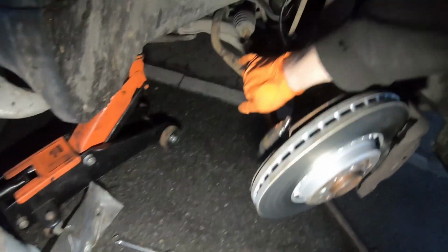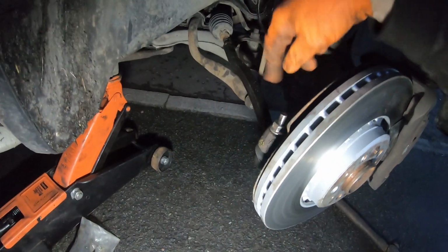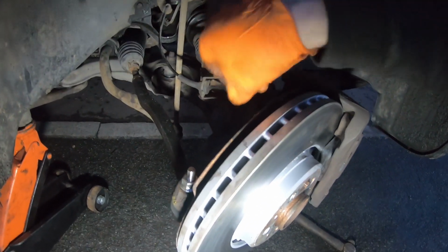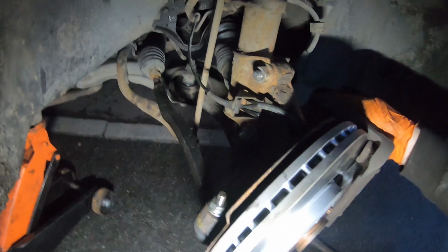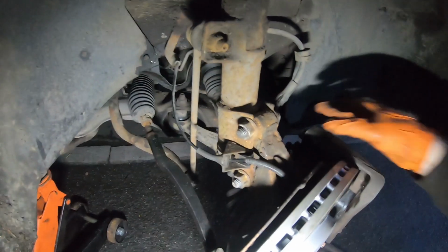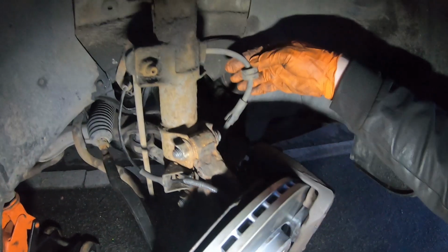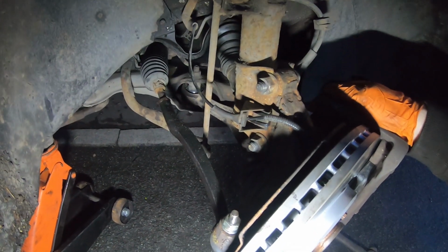So I've got the new track rod end fitted, and the ball joint was loose on that. That's all nicely tightened up. I'll give that a spritz of white grease, and I managed to fix one of the advisories, which was this bracket for the ABS sensor wire. It was cable tied, and the cable tie broke, so I thought I'll just fit 2 cable ties, and hopefully that should secure it. So that's one fixed. Well, it's both failures, and the advisory's crossed off the list. So book it in for retest, and it'll pass.